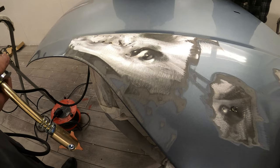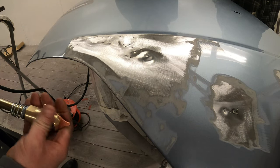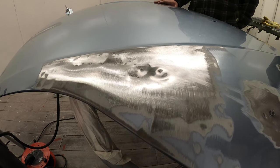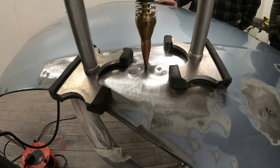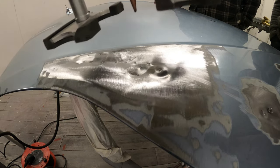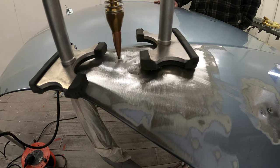That gives you an idea of where we're at with it. On a live vehicle where 80–90% of the damage is removed, we'd then use an additional optional tool called the manual liner. This extra tool is basically a finishing tool so you can really fine-tune the metalwork to get it as close as possible, minimising the amount of filler needed — just a skim of finishing filler rather than piling it full of filler.